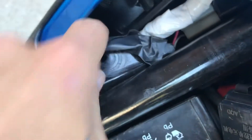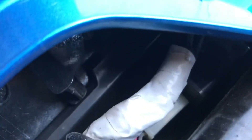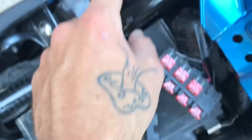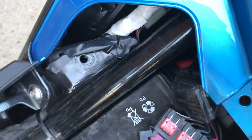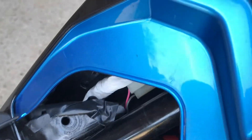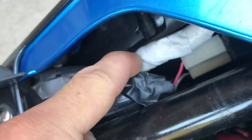It's quite a sharp bit of the frame just here. What happened is the wires — a big wire loom under there, a whole group of wires — were cable-tied to the frame there. What was happening was these wires were obviously rubbing all against here. Five of the wires broke through and got damaged. I was in here putting fuses in and all of a sudden I saw smoke start coming out, as they were setting on fire — I could smell burning. I managed to get the bike started for a second because the cables had moved back, then I realised they were all setting on fire down there. I had to split apart all the wires down here.